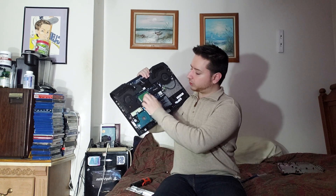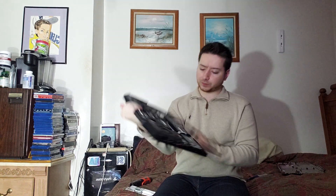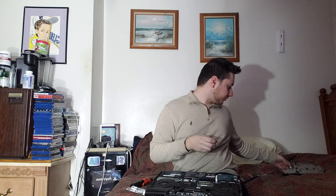The RAM is located right here, if you guys can see. It's also interesting that it has an internal battery that you really can't replace without opening it up. I can confirm the first stick here is an 8 gigabyte stick — I'm going to put that one to the side. The other one is a 4 gig stick. So this 4 gigabyte stick here is the one we're going to be replacing.